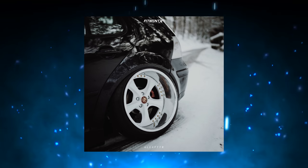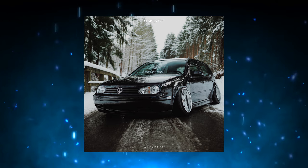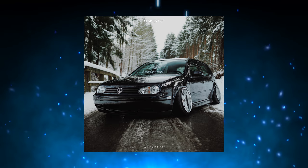I'll let Dakota take this one. So this is interesting — I'm actually a pretty big fan of stance cars, but this is pushing the limits. He has 17 by 9.5 negative 13, 17 by 11 negative 11 wheels on a stock body. He's pushing a pretty good amount of camber, and I kind of wish the fitment was a little bit better. The wheels almost seem a little too big — he's laying out onto the tire in both front and rear. I would really like to see a smaller tire size, but he's already at 205 on a 9.5 and 235, so that's not really an option. I think the wheel's got to be a little smaller. I'm a huge fan of the Work wheels, but on a Mark IV Golf I don't know if they fit, in my opinion.